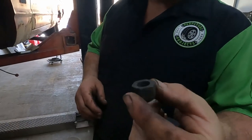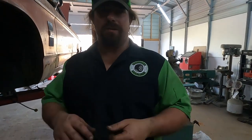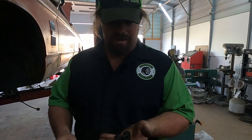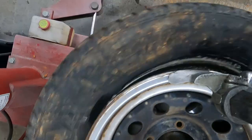So I just sandblast them, and I've got this stuff called Caswell black oxide. Soak them in a solution of that in water. I usually do overnight. And then there's another one that's a penetrating oil that you soak them in, and it's supposed to keep them from rusting. Thought it was pretty cool. I got a little pint of that stuff, and I've done all the bolts, or most of the bolts on the Jeep, and I haven't even gone through the first mixture of it. So nice to not have to put rusty lug nuts on.